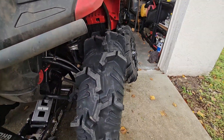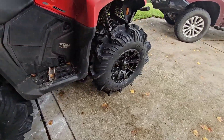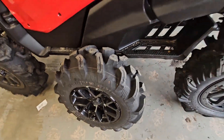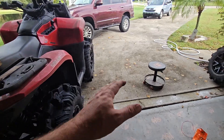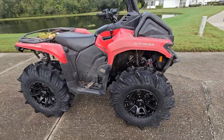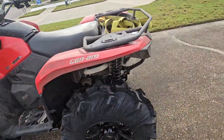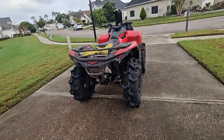The Stars do look pretty sweet. They're a little ballooned out because I've got 16 PSI on them right now since I just set the beads. I do have the 1-inch wheel spacers in the rear and the 1.25-inch wheel spacers up front — that's what I had on there when I was running the 6-plus-1 wheels. These factory rear wheels are fairly deep dish, so without the rear wheel spacers a little thicker, it'd be a little too narrow in the rear. Right now it's either perfectly square or a little fat in the back, which is honestly good for stability. There's how it sits with the 32s on 14s. It's definitely pretty stanced — the tires hang out past the fenders a little bit, so you're going to get pretty dirty. Ground clearance is really good, and the machine is all stock — I just bolted tires to it and did some trimming.